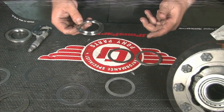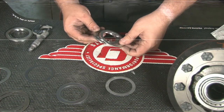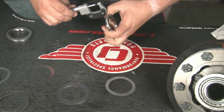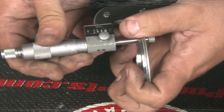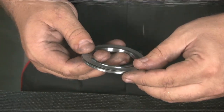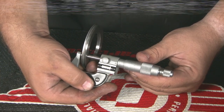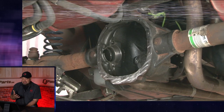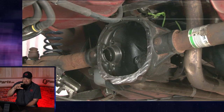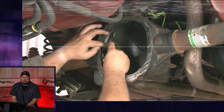Ordner now has assembled new shims for our carrier before we install it. You could reuse the old ones, but we are going to choose to use new ones here. Put it together and just start measuring it out — go off the measurements of the originals, that's a good place to get started. We're at 235 and we need to get closer to 257. There we go — that'll be right for our left-hand side. Now we'll make up for the right-hand side. A lot of people questioned the pattern: 'Why is the pattern not in the middle?' In a perfect world you would move it down a little bit, but having it just a little to the outside, I've never had any problems doing it that way.